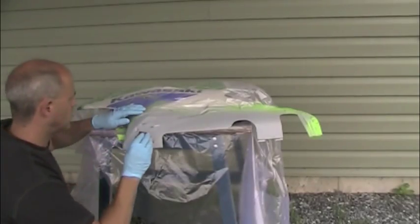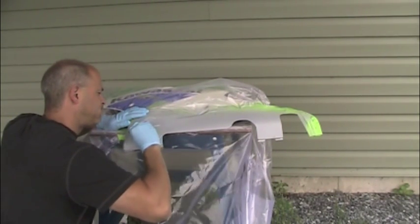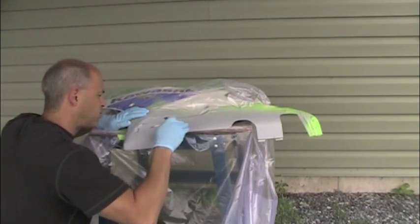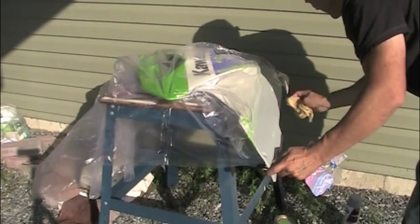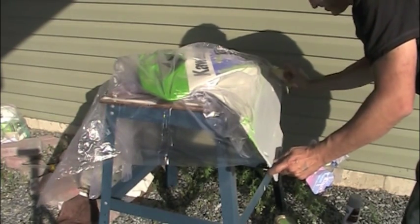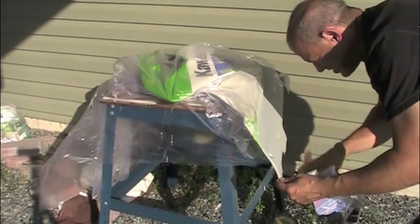I'll do very, very little filling — actually on this one, this will all be sanded. All these imperfections wouldn't be anywhere near as deep as a sheet of paper, which means it's something that can all be accomplished by sanding. But I do want to get all these imperfections out. So here, laying my panel out in some sunlight, I start going at it with sandpaper, starting with the heavy stuff and moving up to the finer stuff. Once it feels smooth to my finger, I run my tack cloth over the top of it. When the tack cloth is done, I wipe it and then run a second tack cloth over top of that. It's only two minutes, but this little bit of extra work makes all the difference in the world.